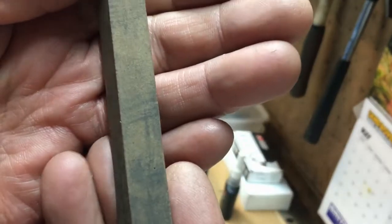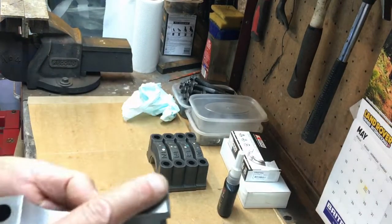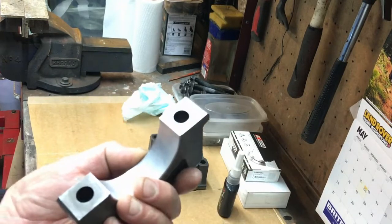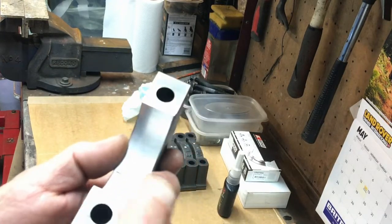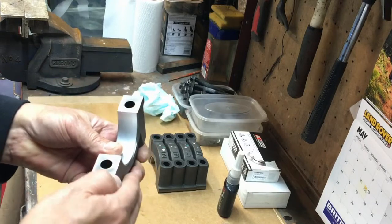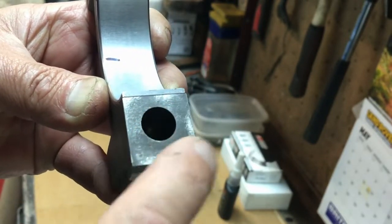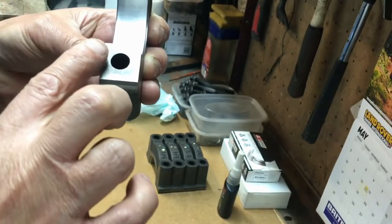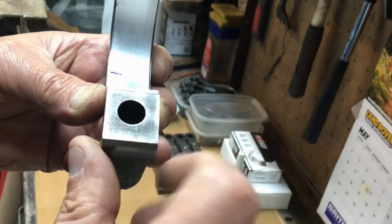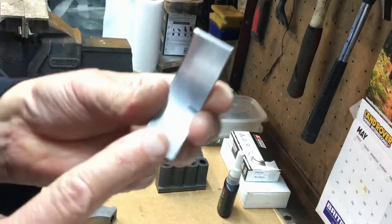Then I've got a square section stone — my finest one. It's literally just a very very fine grinding stone. What we do with these is, for instance on the mating faces of bearing caps — they have lines in them from a milling cutter — we just want to remove any raised edges where the cutter has come onto the surface and pushed off.